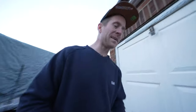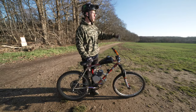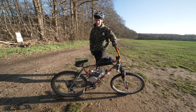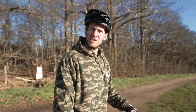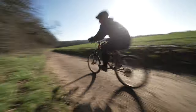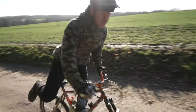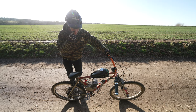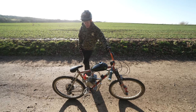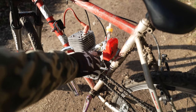We're running out of daylight so I'm gonna get it fueled up and head into tomorrow. It's now the next day and we have some glorious sunshine ready for the shreddy session on this beast. I'll start by blasting down here as fast as possible. The beast works but it's the same as the other one – it's still bogging on full power and doesn't take over. I've tried adjusting the screw on the carb but whatever I do it doesn't change, which is really annoying.